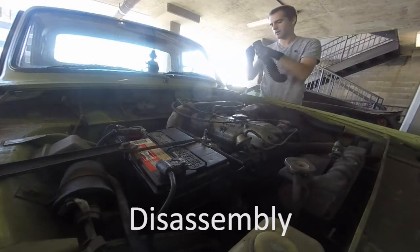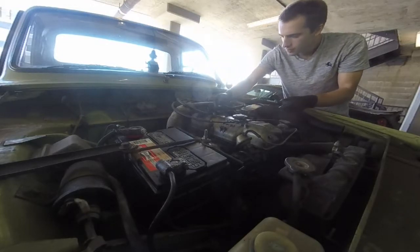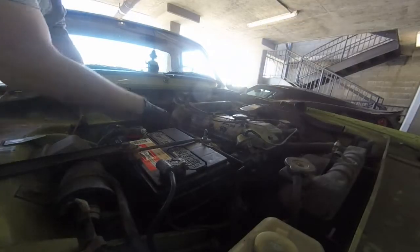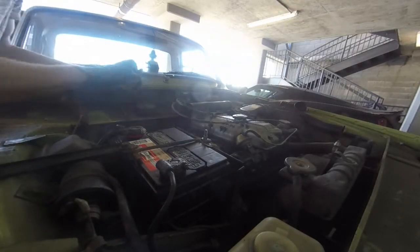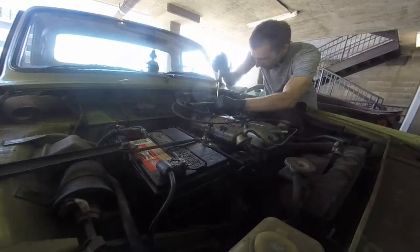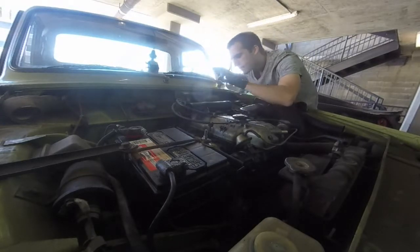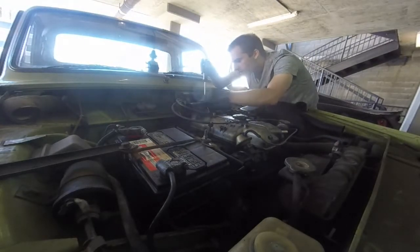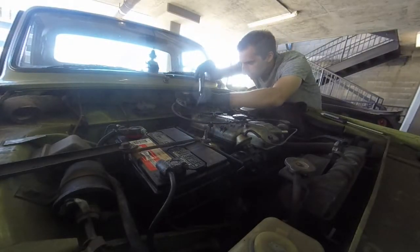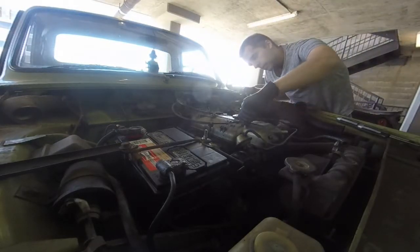Next I'm going to take off the air intake pipes. These pull intake from around the exhaust to heat it up on a cold day, which I don't really have any of, but that's what it's there for. And that's the crankcase vent that goes back into the carburetor. That's another vent — I don't know what it does but it's there, so that's where it's going. A lot of this stuff is just simple disassembly and reassembly.